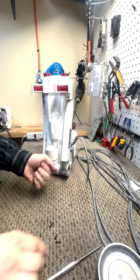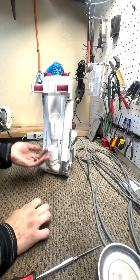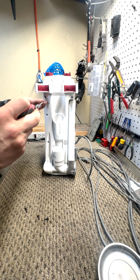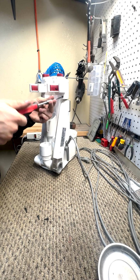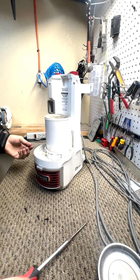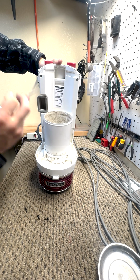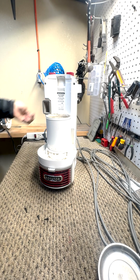For the bottom, you are going to have short screws. For the upper portion of the body, it's going to be long screws. Make sure you don't mix that up or you can ruin the screw mount. Now we can flip back to the front, put in the screw here, here, 3, here, here, here, and 4th one there.